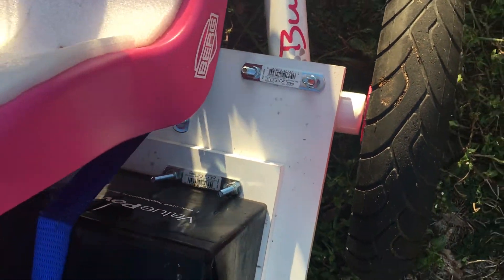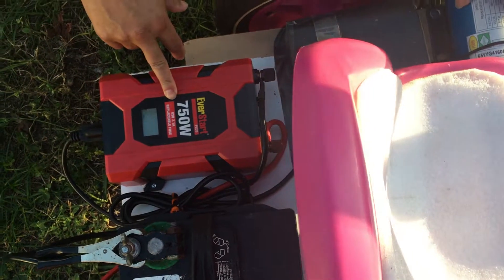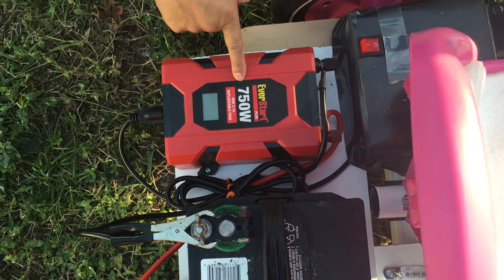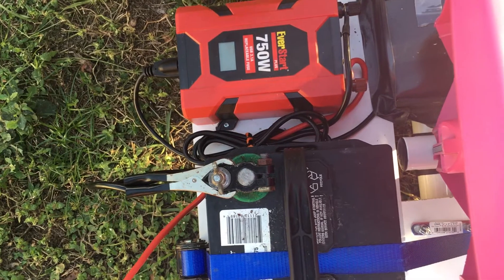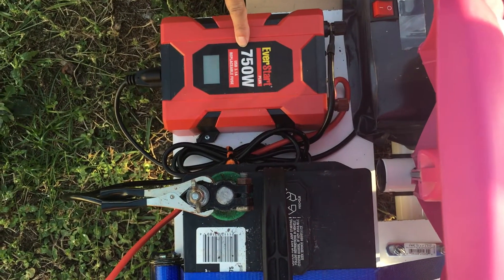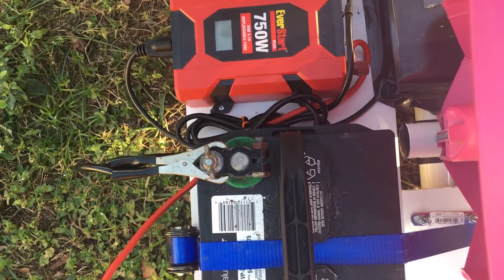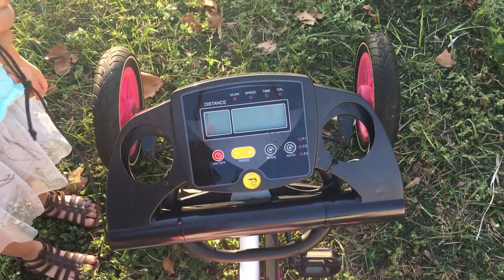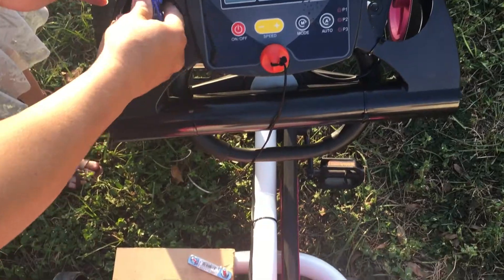There's a particular reason I chose 750 watts — because this motor can only go so fast, and the 750-watt inverter will shut off if it goes too fast. For a little five-year-old, you obviously don't want them going too fast. So when it reaches the maximum the motor can push, it'll stop. Just in case a five-year-old like Eva pushes it too fast, it'll just stop. This thing can go pretty fast with no weight load, but when you put weight on it and go too fast, it stops. Up here is also an emergency kill switch — the treadmill key — attached to the rider. If the person falls off, it'll pull the kill switch and the bike will stop.